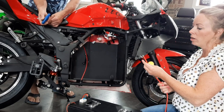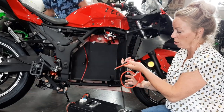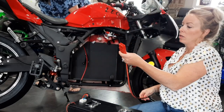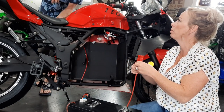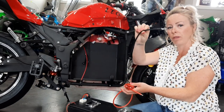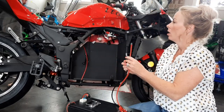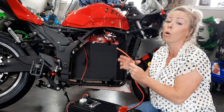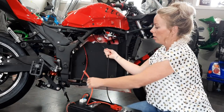Darren's doing it the proper way. This is called an Anderson harness, and this is what comes with lithium batteries — you can also get the charging port. The proper way is that this harness comes with a connector that will go right through the controller. However, a shorter step — cutting corners I would say — is actually soldering black to black and red to red.